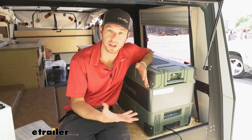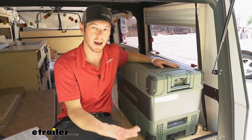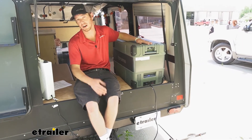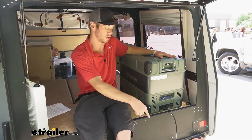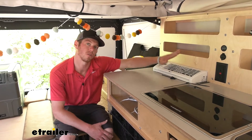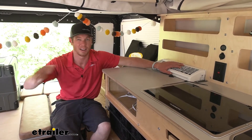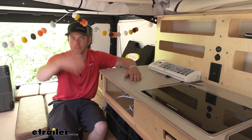A lot of you are wondering how much cooling power you can get from the ArcPak. This right here is a 40 liter camping fridge with 12 volt and 120 volt inputs. Hooked up to the 120, it's cooling about 10 degrees in about 10 minutes — it started at around 80 Fahrenheit but is cooling rapidly. Something more efficient like this can run off the ArcPak no problem. When it comes to AC, even a relatively small unit draws about 520 watts, which is a little too big for the ArcPak. If anything is under 300 watts while running, you can use it with the ArcPak. Anything above that, I definitely don't recommend. Check the components you plan on running to make sure they fall within those bounds.